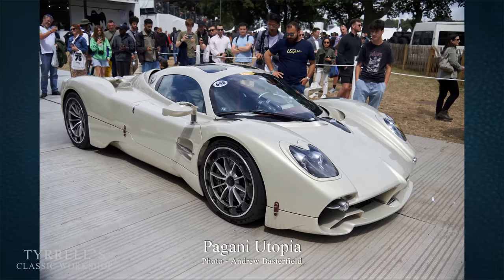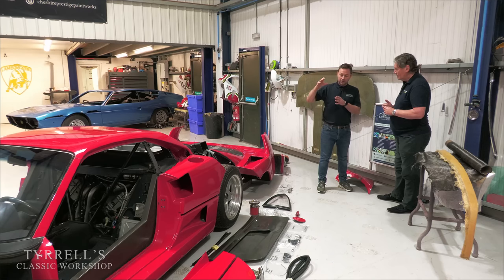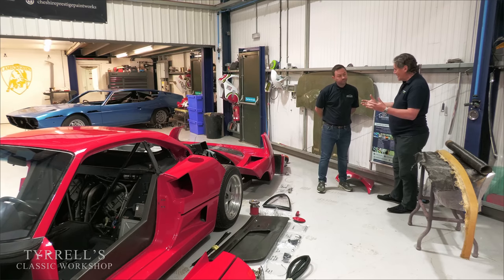Now, on modern supercars like the Paganis, your Koenigseggs, and the McLarens, the process is that much better and the top surface is that much better and you get the reflections. These are quite an inconsistent layup. So you get this inconsistency in the way it's made and manufactured, and the product that's painted on the top actually sinks into the base layer, if you like. And that's where you get your carbon fibre weave from. That's where you see the weave. All the product that sat on top of the carbon fibre, which is quite raw and old tech, is being printed through onto what is at the bottom.